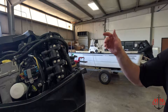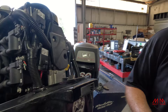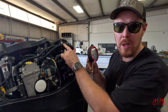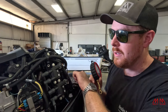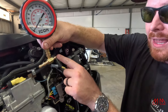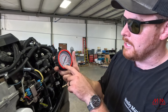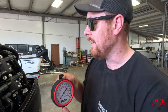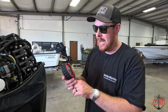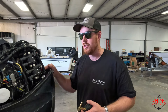So that's step number one. Step number two is we need to check if his low-pressure fuel pump is getting the correct pressure. What we did is we took our fuel pressure gauge, disconnected the fuel line right here from the low-pressure mechanical pump that feeds the VST, put this in line, and checked it. The only downside to this gauge is it starts at four, and it's barely passed — this is supposed to read above five, like four to six. It's barely moving. We suspect that this is also the issue — we just don't have enough power here.